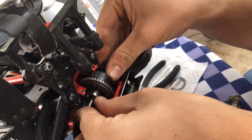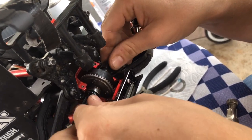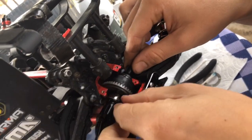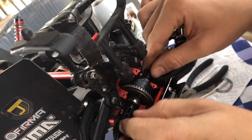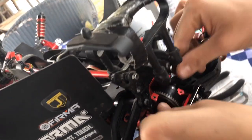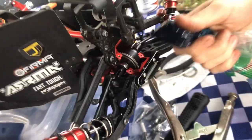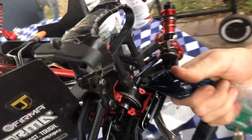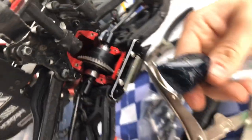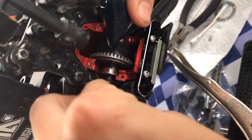This is a tight fit — but that was actually almost perfect. Almost a little loose — there we go. Just like that. You've got to remember to put some grease on the outside. Some people say you don't need it but I don't understand why you wouldn't on some gears. So I put some waterproof marine grease in a zip-lock baggie — just going to put it on like cake icing.